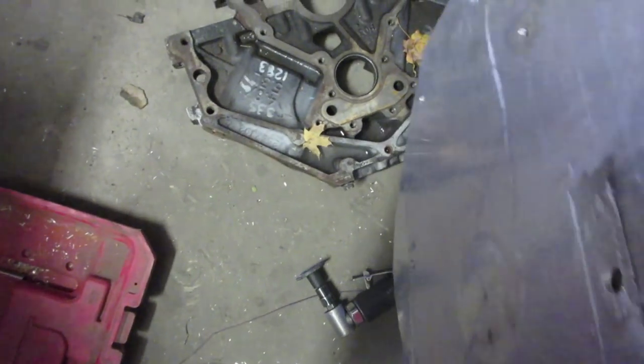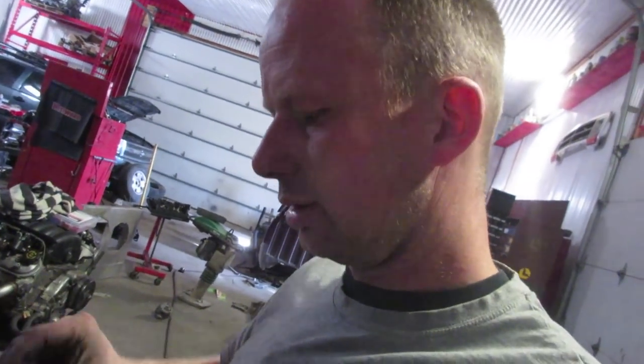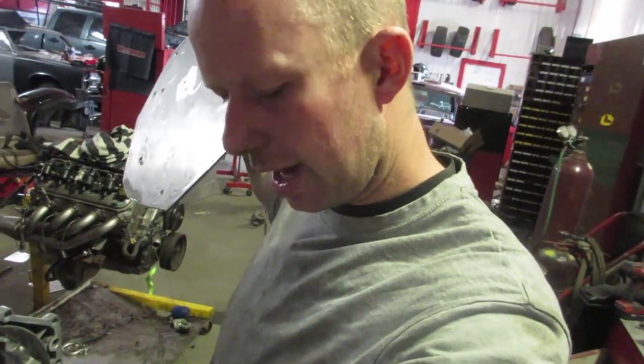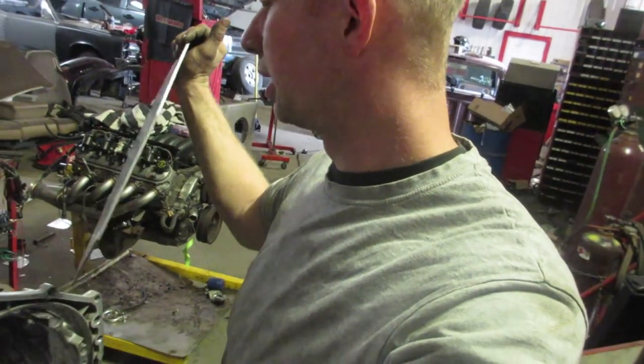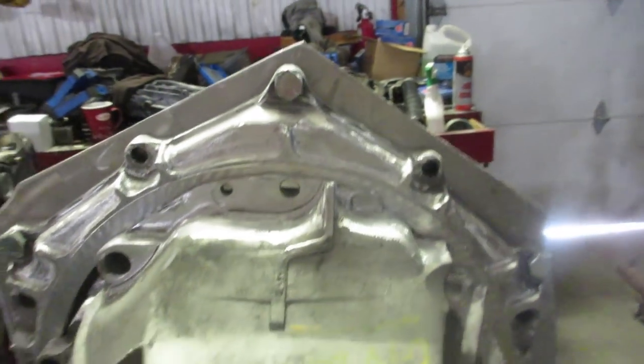And I got the back plate here. We'll bolt the actual bell housing to this plate. And when we weld it, we'll just hold it upside down. It'll be sitting like this, like a pizza pie. That cast iron will keep this from warping, and then we'll keep this cold as we weld it. So, should be interesting. Stick around.